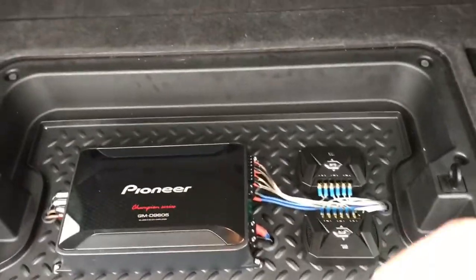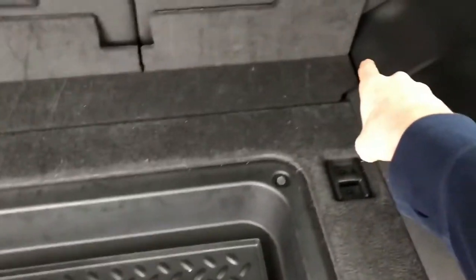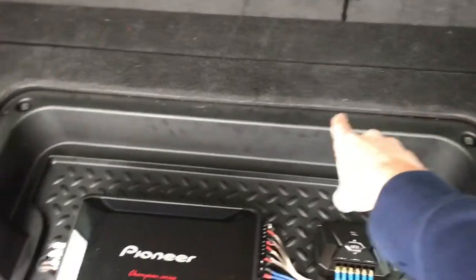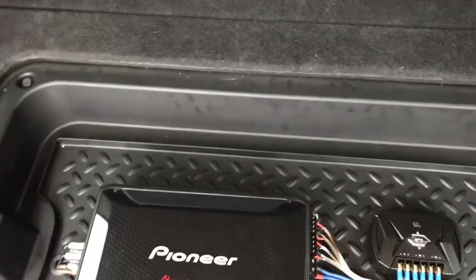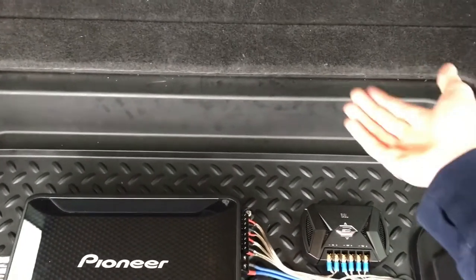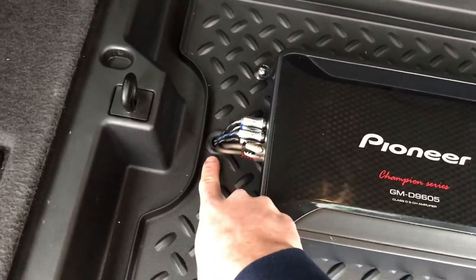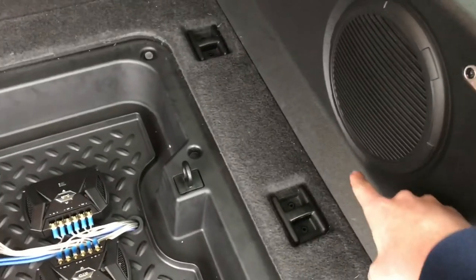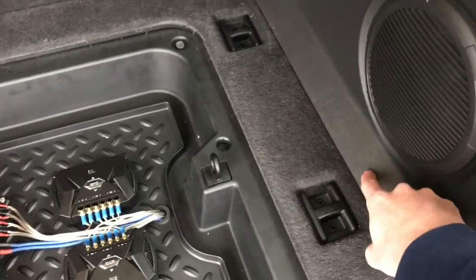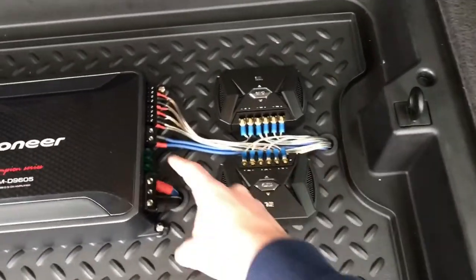For the RCAs, when you take out the entire bin there's a carpeted mat below it. I had the RCAs running up by the wheel well and brought them straight across — since there are no ridges on the back side up in that area, I didn't have to worry about them getting crushed when putting the panel back down. I cut two parallel slits in the carpet, ran a zip tie underneath, and tied it down to keep it from moving or bouncing. Then I brought it all the way back around on the outside of the ridges and up into the amp. Speaker wires were the same — had them run back here, zip tied around the carpet, and had the sub wire feed into those wires up front and run up through the hole into the inputs and the crossover.